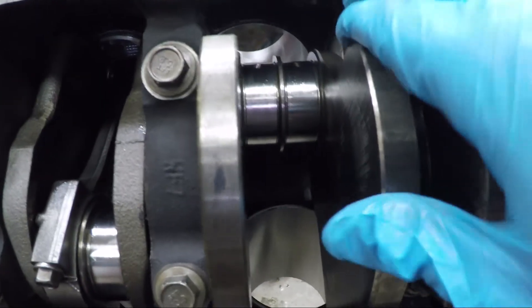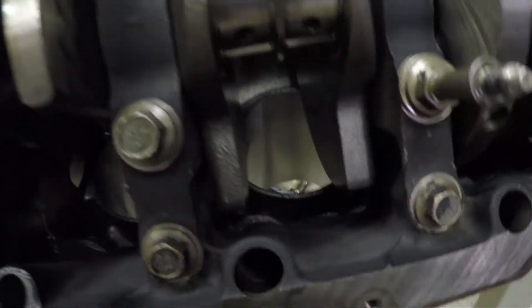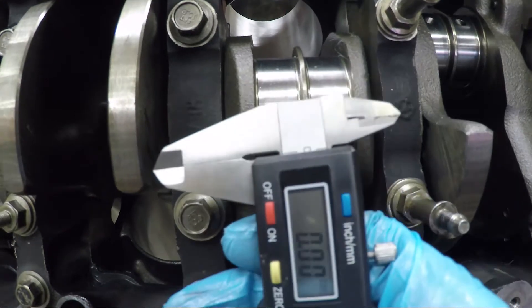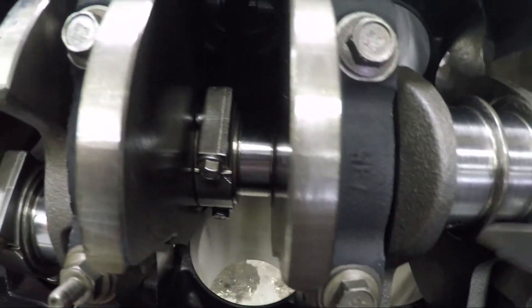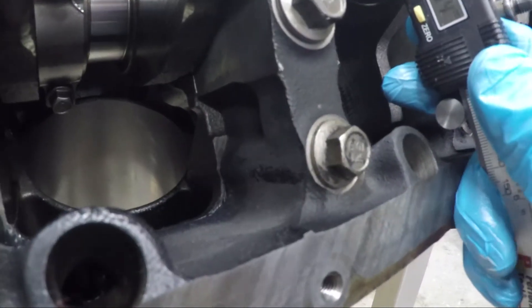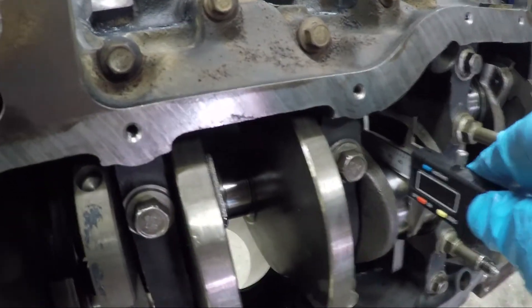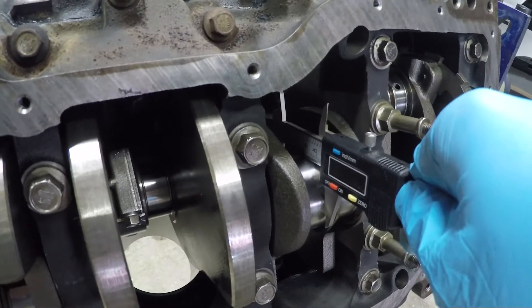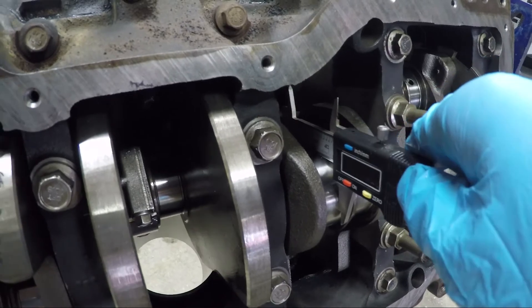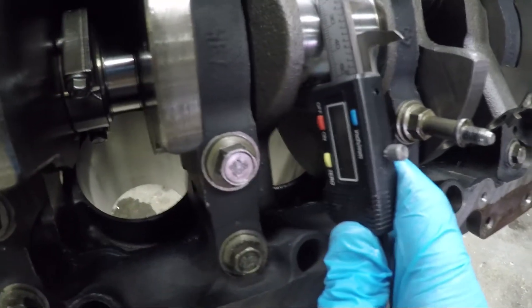Now I'm going to come over here to the crankshaft where that connecting rod is going to be. I'll wheel that out here — it's going to be this one because I can see it lines up with that cylinder. I'm going to zero it out and do the measurement here. Got 51.12. I'm going to check it both ways, perpendicular from each other. So we got 50.73.